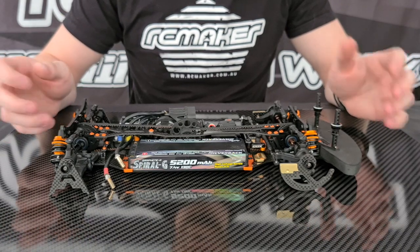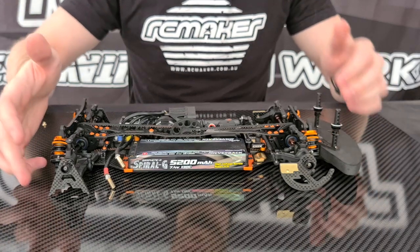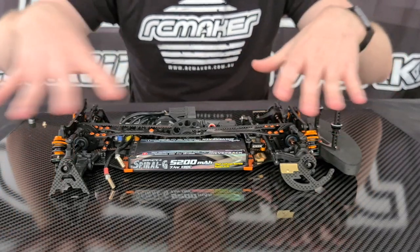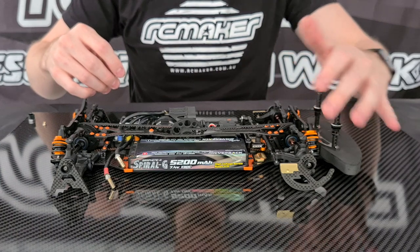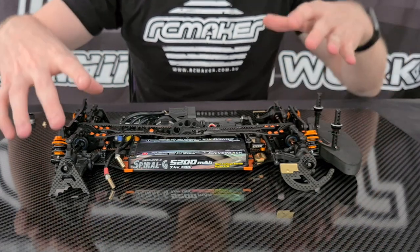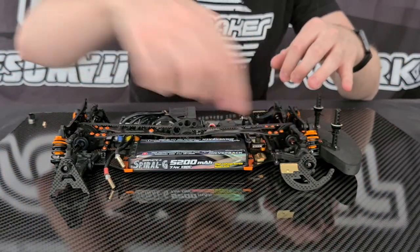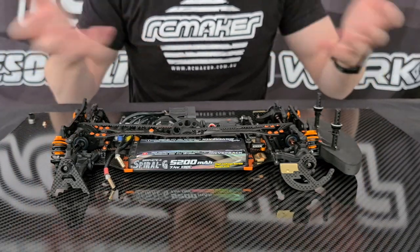But this way makes it super easy — you can literally screw all these on, flip them front to back, and you'll be on your way. We have the A-frame rears which basically stay stable and allow you to work just on the front without anything rolling around. These hold the car nice and stable while you're working on the front to do the tweak. When the front wheels are on you're doing the tweak at the back, and when you swap these wheels around you've got the A ones on the front which are fixed, then you're working on the rear.